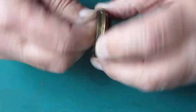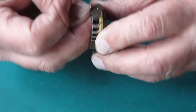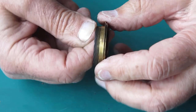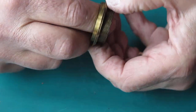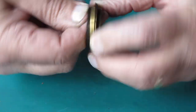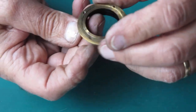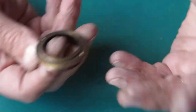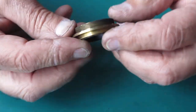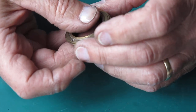I've put a bit of naphtha on there and I'm just running these pieces over each other. Sometimes the surface roughness is just a little bit of oxidisation, and running the two brass surfaces over each other with a very light lubricant — naphtha is exceptionally light as a lubricant — means the pieces will rub off those high spots and things become smooth. I'm just running that through its range — that feels good now, it's nice and smooth. Having rubbed off any high spots like that, you can disassemble and reassemble and it'll still run smooth — we're not relying on a liquid lubricant. The naphtha has probably evaporated completely by now.